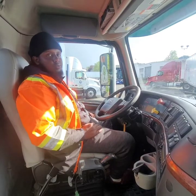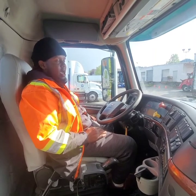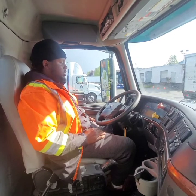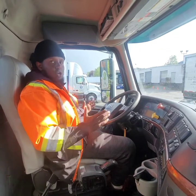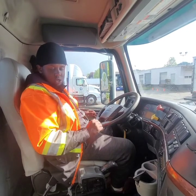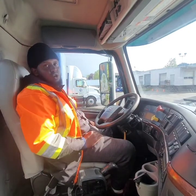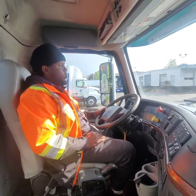Hello students, my name is Hamza. Today I'll be helping you with your in-cab inspection with an automatic transmission, coming from Skyline CDL. I'm an instructor in Auburn, Washington. Always when you're starting your test exam, you always chock the wheel — never forget to check the wheel, that's the first thing you always do. Once you've chocked the wheel, let the examiner know you'd like to start by demonstrating the exterior lights.